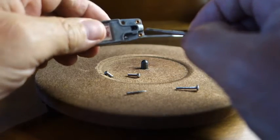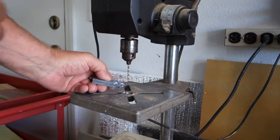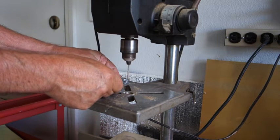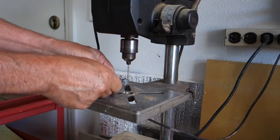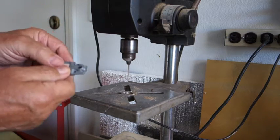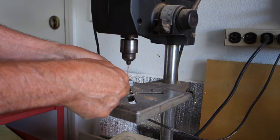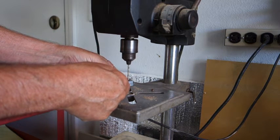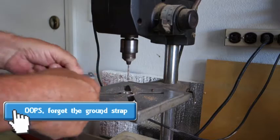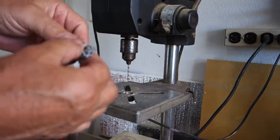What you want to do is just drill the top off so you can pull the rivet out — not go all the way through. This housing is real sensitive. I was in a hurry and went all the way through, which is not good, and it broke part of that housing. I'll show you what happened. Here's the housing — it's still usable, not pretty, but usable.